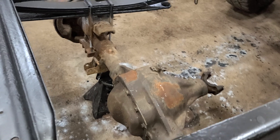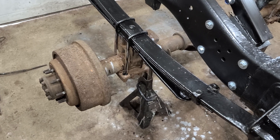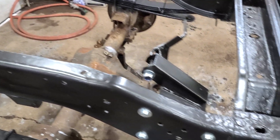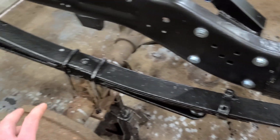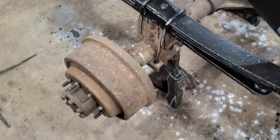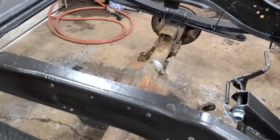What I've been able to find out online is this axle weighs about 480 pounds dressed up including the drum brakes. So I hope I didn't buy my tickets to ride on the struggle bus here. I'm going to start by lifting the frame a bit more, support it with jack stands, cut the u-bolts on each side, then lower it down onto furniture moving dollies — good for about a thousand pounds each — and get it to the front of the shop.